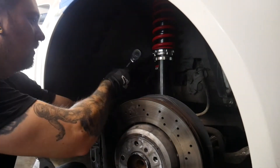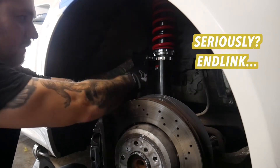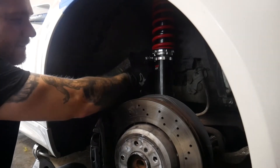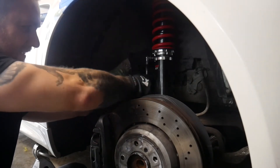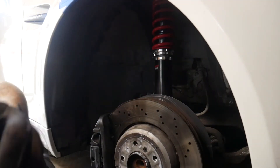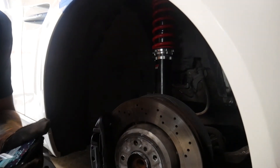Verified the sway bar stabilizer is in the right spot. One important reminder: before you tighten the lower control arm and front control arm, jack them up a little bit first, then tighten. Don't tighten them while they're low and then drop the car — that's the exact opposite of what we're trying to prevent. Then wheel liner back on, wheel on, and drop it.